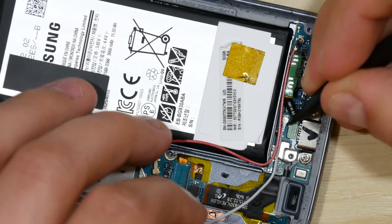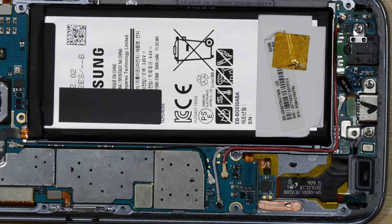Then put our gray cable in — it goes right above the charge port and then to the furthest left side of the phone. Make sure you put them in and then route the gray cable, then the red cable on top through the guide slots.